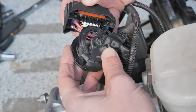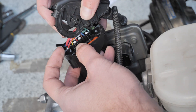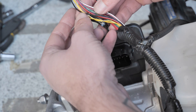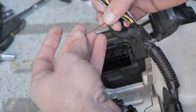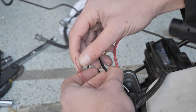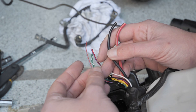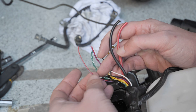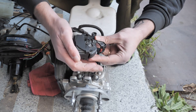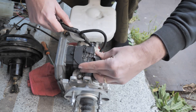So positive, ground, and then third from the bottom — it's hard to see, but it's going to be the little red one. So this one goes to the positive on the battery, the negative on the battery, and then this goes to the key to give power whenever you turn on the car, then this thing's live. That's all I needed to know. I'm excited. Why they thought it was a good idea to make every iBooster's wiring different colors, I don't know, but it's all good. Figured it out. Thank you, internet.